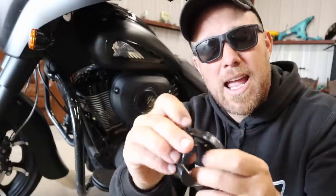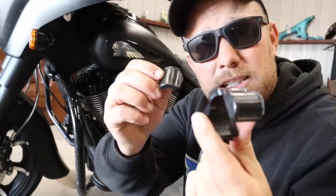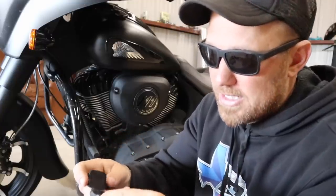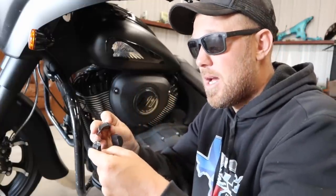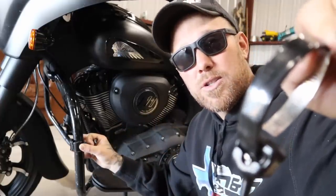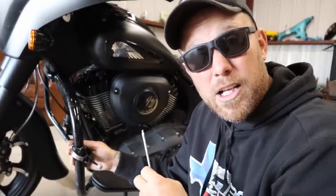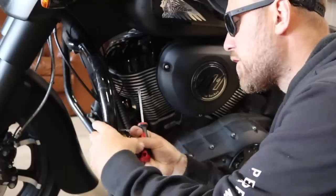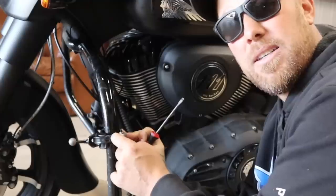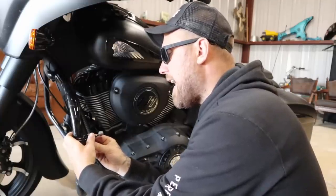I had to wash it up a little bit since I use it on the side-by-side, but I'll order myself another one. It's got these little squares you use to adjust for whatever size bar you want. It actually says on them how many to use for each bar size. For me I'm going to use three plus one for the thickness of this crash bar. The clamp has a nice sleeve covering it so it looks finished — not just a hose clamp hanging out. You just tighten it up. One trick: as the hose clamp tightens, that second part is going to come out — you want it to feed inside the black sleeve so it's covered all the way around.